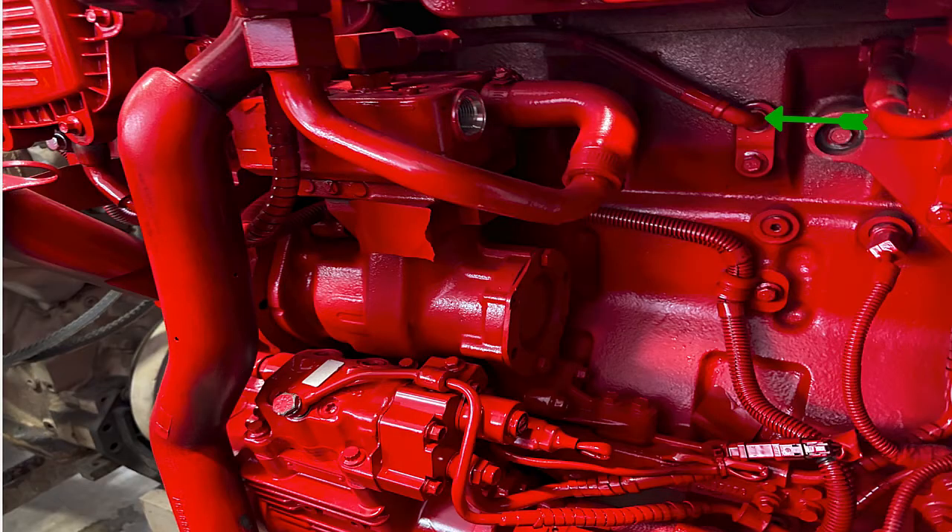These arrows are showing the coolant lines — the compressor head has an in and out line. On the right, the green arrow is showing where water goes into the block. Those hoses are held into the block by brackets. You take this plate off and the power steering pump bolts in the back there. The air compressor head is the section between those two green arrows. Usually you've got to pull the intake to get that head off. Most of the time, heads got changed because they carboned up real bad — you'd get EGR going into the intake mixed with air compressor air.